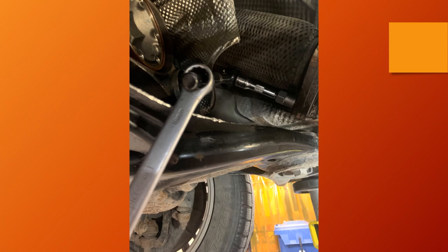Now turn attention to the flange where the primary catalytic converter flex pipe connects to the main catalytic converter — it's held on by three nuts with studs coming from the main catalytic converter side. It's difficult to get a wrench to fit in here with enough leverage, so I used a 3/8-inch ratchet and a ring spanner wrench to give more leverage to get the nuts off. The nuts on my car had never been off before — they were quite corroded and I couldn't get a socket to sit correctly on them, so I ended up using a nut remover.